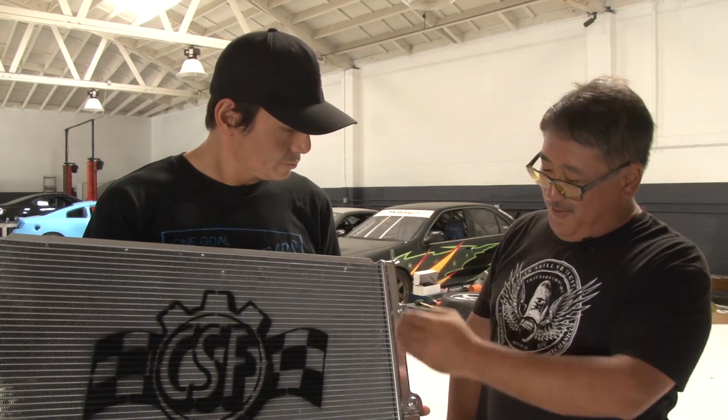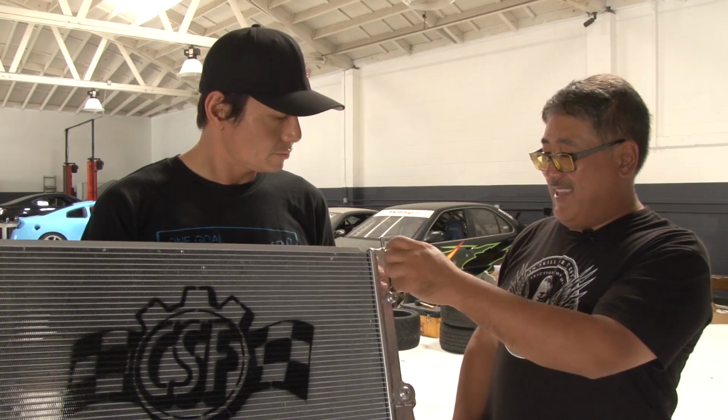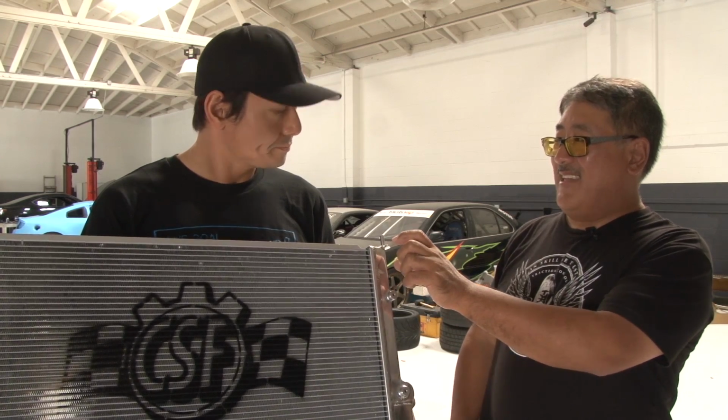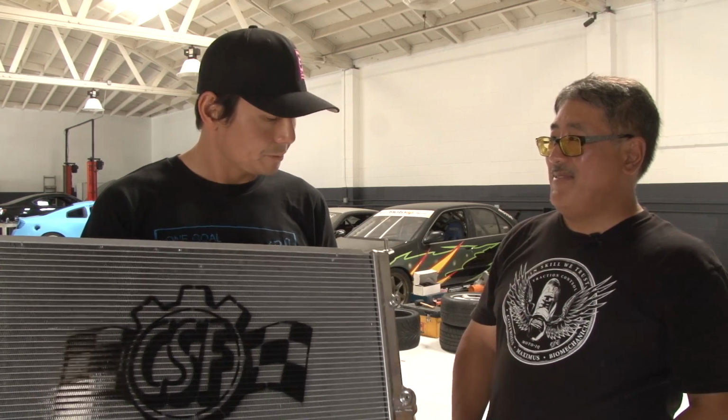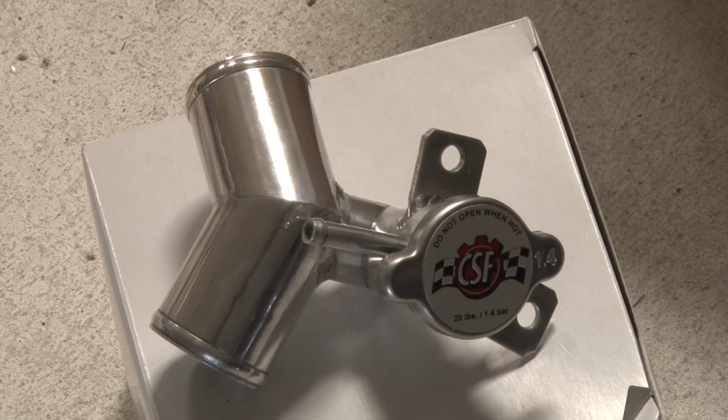Cool. And then it has TIG welded end tanks. The stock radiator has these plastic ones with a gasket that are crimped on, and that can develop leaks at high pressure. Okay. And the reason why we talk about high pressure is we're running this special radiator